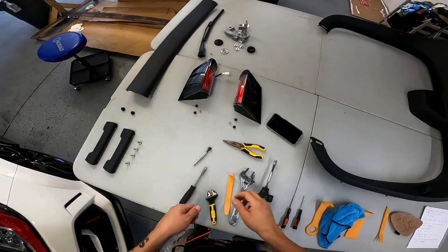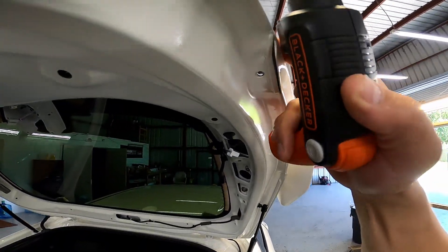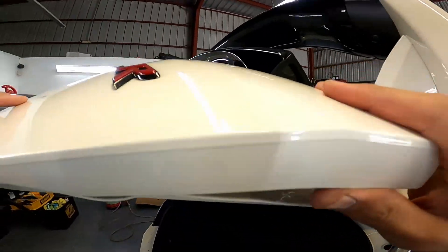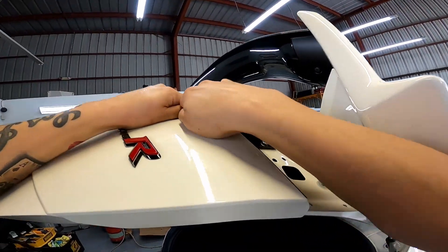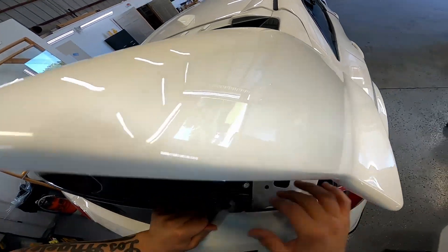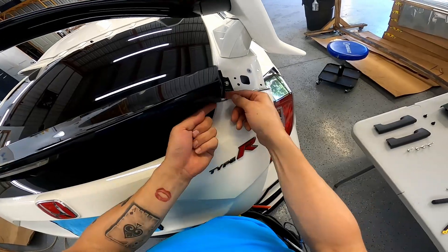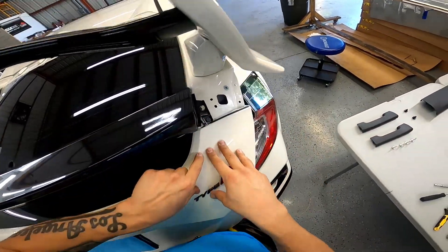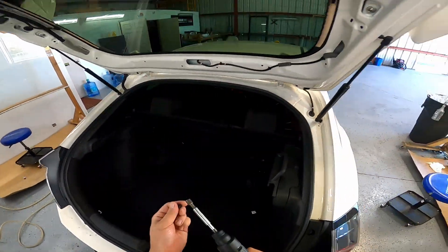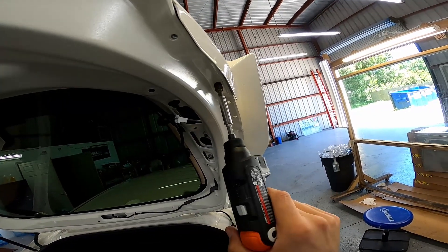I'm going to take these four 8mm bolts and put them right back here, holding the body panel — one right here, one right there — back into place. It's not wanting to pop back in. Make sure the body is not caught up on the bottom of the spoiler — that's what was holding it. Once those three pins are in place you should see the threads. If you don't see the threads, the pins aren't in place and the body is not back where it's supposed to be.